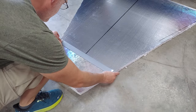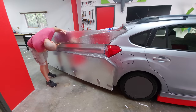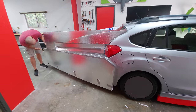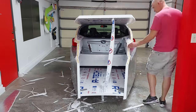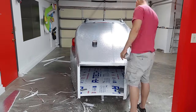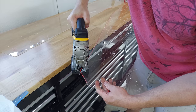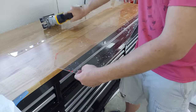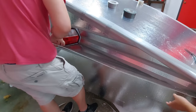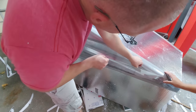The extended tail was constructed using the same methods as the previous tail, but with a few differences. The top of the tail was curved more towards the ground, and the bottom was kept as low as possible without knocking it off on uneven streets. I did not taper the sides as aggressively as the original, as too much taper seemed to be a large source of drag on the first car. The number one suggestion from the last video was to add clear plastic over the void left in the first tail to keep the tail lights visible. My local Lowe's had stiff clear plastic; a little heat was used to contour it, and it was secured with duct tape.